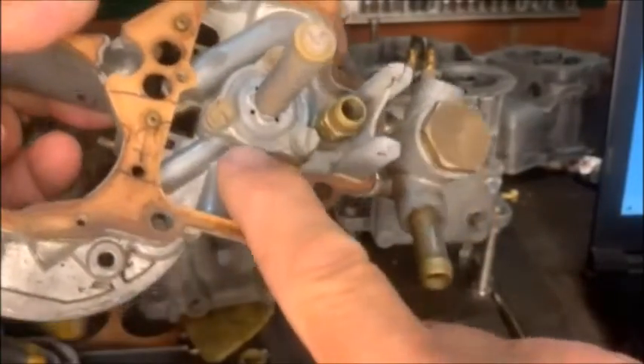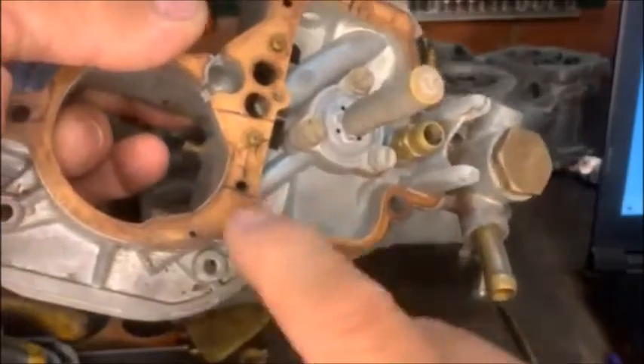There's a diaphragm below there — it gets air through that hole from below the butterfly. The third system, and not all carbs have it, works through the accelerator pump jet. The carb has an extra additional diaphragm on the side with a little pipe that also goes to below the butterfly and on the second choke. When you go full throttle at low RPM with the butterfly closed, there's loads of vacuum so it pulls the diaphragm. As soon as the butterfly opens and the vacuum drops, the spring pushes the diaphragm back and it squirts additional fuel through your accelerator pump nozzle. I'll show you how that works.